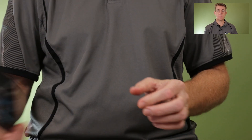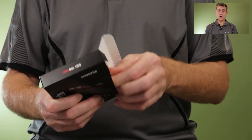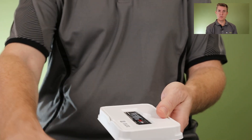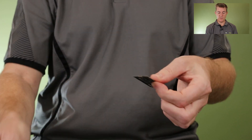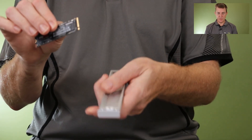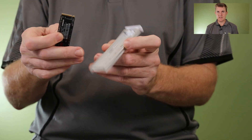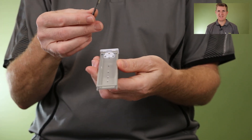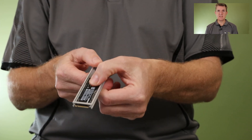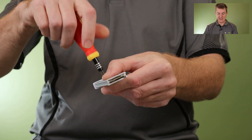Let me set that aside. We're going to swap this for a good-quality drive — we're going to put a Samsung 990 Pro in. This is a two-terabyte model; there should be no issue going higher — there's a four-terabyte Samsung drive available too, and in the same format it should fit and work. You can see our new card. There are lineup holes in the tray to show you where to place it. We pop it through into place, push it down, and it fits solidly. Now we can put our screw back in.